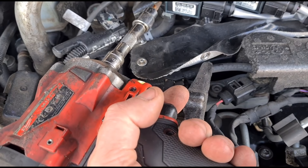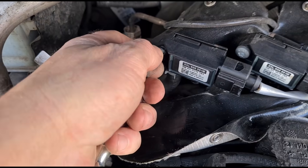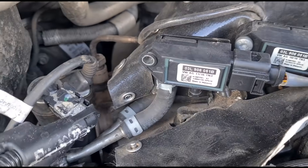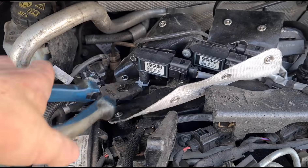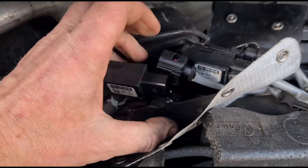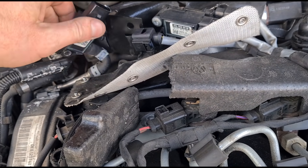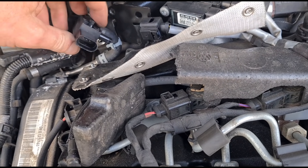I've got a T30 Torx and we'll get that inserted into here. Just get that bolt loosened out and remove it. Grab that sensor, just pull it away from the housing there and we need to disconnect that little clip. A pair of pliers — just grab it there and give it a little twist and pull it down. Release the plug by pressing that tab inwards, pull it out, and we can give this a twist left and right. Try and keep it dead straight — you don't want to be twisting it to the side because you might snap the plastic tube.